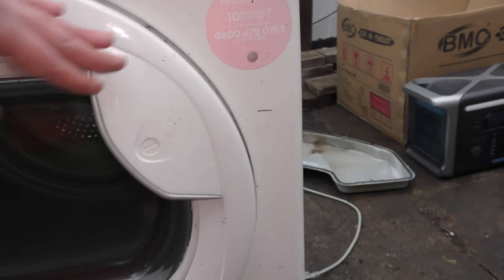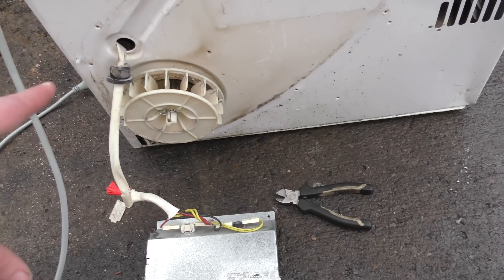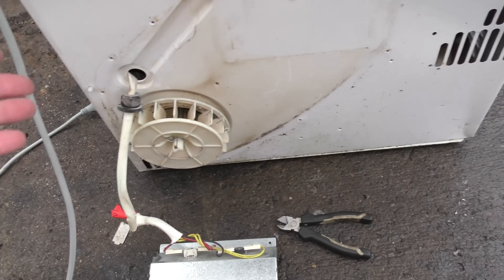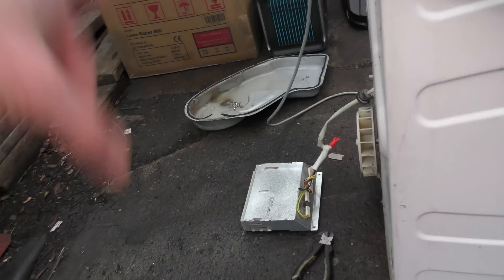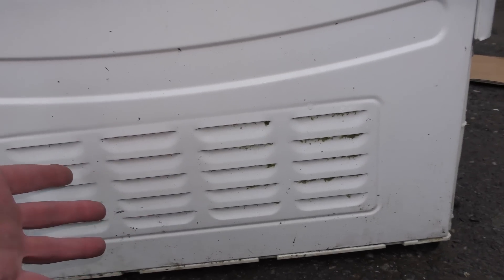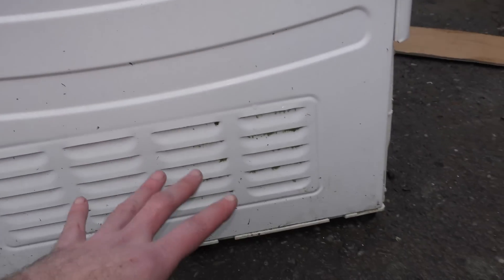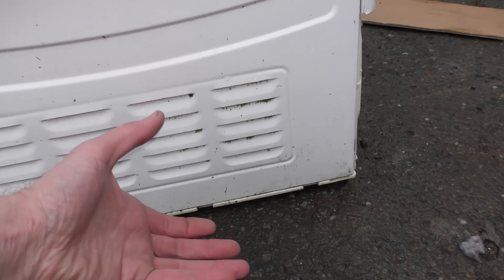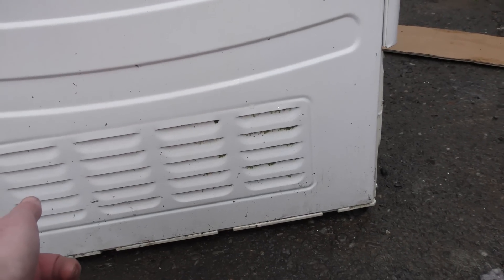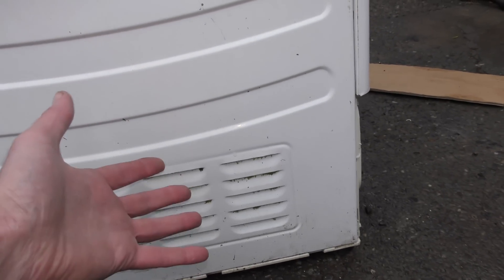So what we want to do is remove this heater element - we can just take it entirely out of the system, put that cover back on, so we'll now have air blowing through the drum. It'll be cold air until we heat it up. The intake for that setup is these louvers here. So I suggest drilling a hole about there, blocking those ones off, maybe blocking the ones off at the back, and then just plumbing the external diesel heater's output pipe right in there, then we can turn it on, fire up the diesel heater, and have hot air sucked in and blown through.